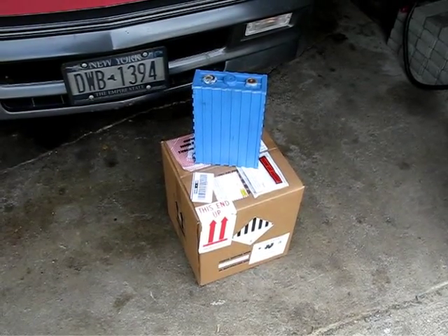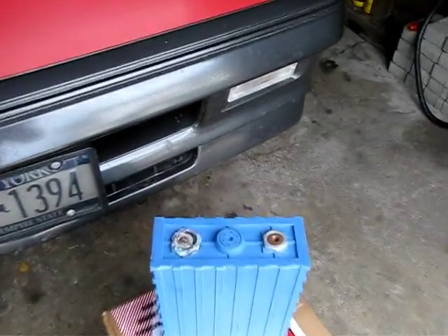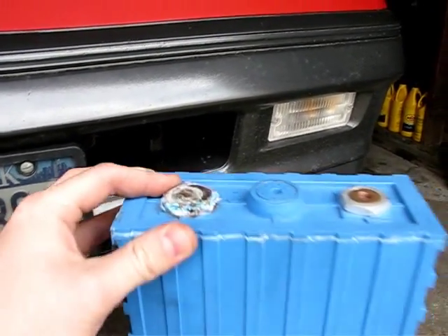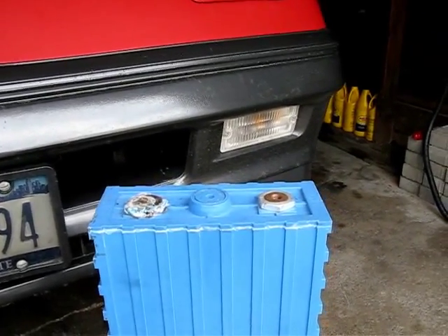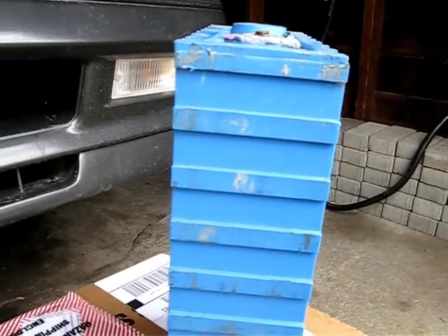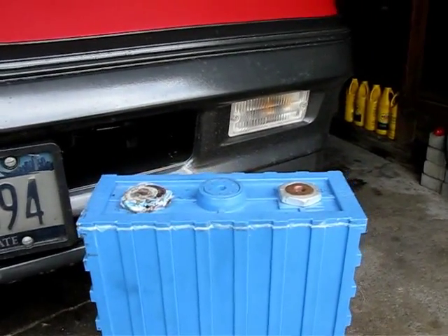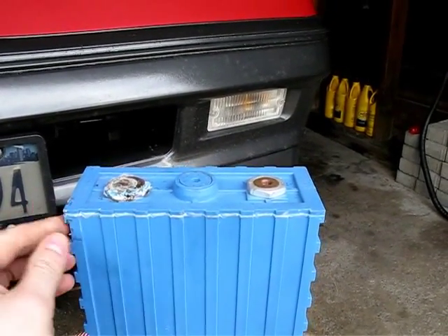As an aside, while I'm here in maintenance mode working on the car — you may remember that back at Evcon 2013, I had melted the terminal on one of my Calb SE 180 cells. You can see how it's a little bit melted into the plastic there, and we had to break off the bolt just to get the thing out of the car. The cell looks undamaged otherwise, and honestly it's probably fine — maybe a little bit of extra heat in this area that perhaps has diminished capacity, but it's not swollen. There's no physical damage to the cell other than the terminal being melted into the plastic a little bit. So I could probably clean this up, drill out that bolt, and actually reuse this battery in the car. However, just to be on the safe side, we pulled it, and I've been running with 59 cells since Evcon.